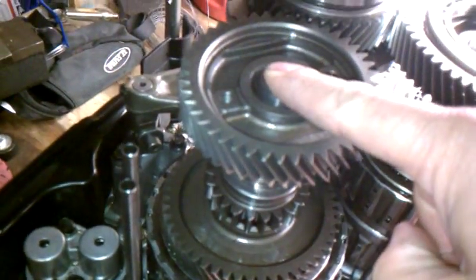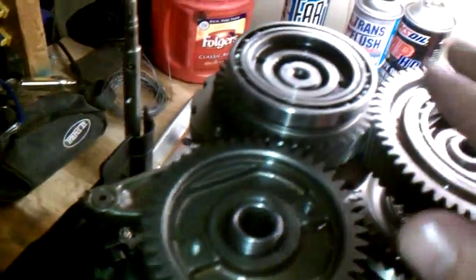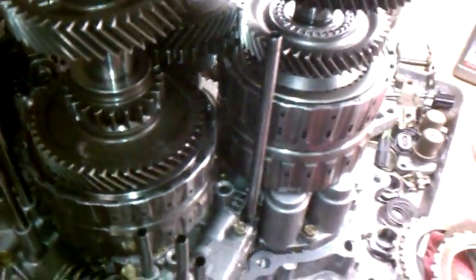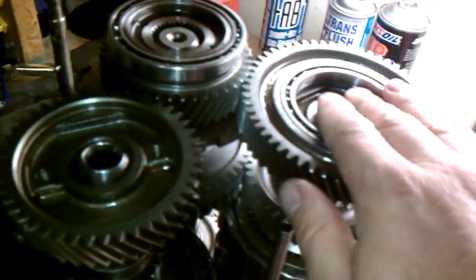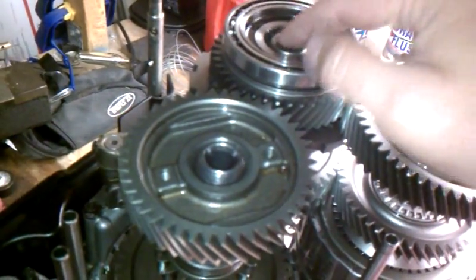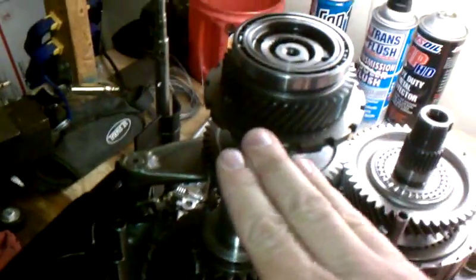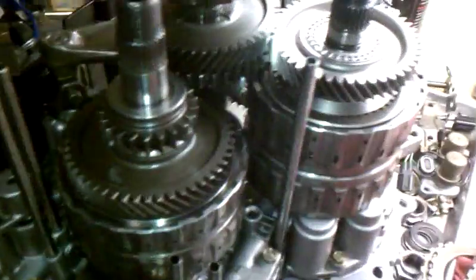As I try to figure out power flow — this here is your main shaft, connected to the torque converter. This is your counter shaft, so it rotates in the counter direction of the main shaft. This shaft here is what they call the secondary shaft. So you have four clutches; it's a four-speed constant mesh transmission. This shaft and this shaft turn at the same speed. This is an idler gear — it's not coupled to this shaft, it just sits there and spins, and what that allows you to do is transmit power over so both shafts spin in the same direction.